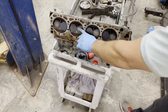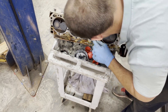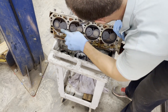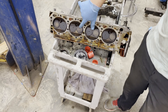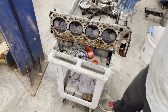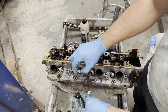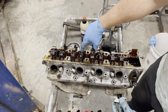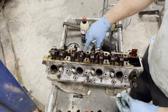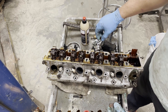Remember, it was this cylinder that had the leaking exhaust valve. All these valves seem to be protruding about the same amount. I took off the rocker and tapped off the exhaust valve that was leaking — it seems to be okay. We'll have to get a valve spring compressor, take this off and see what's holding up that valve.